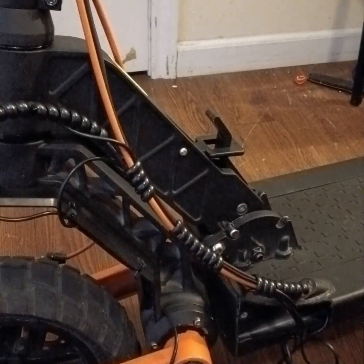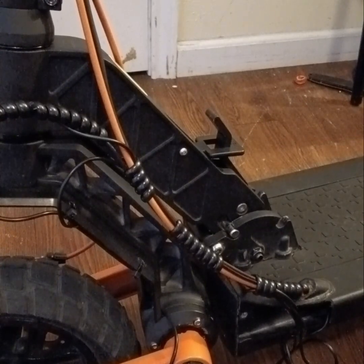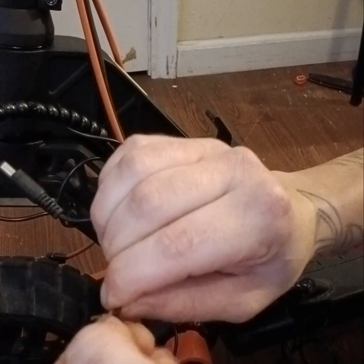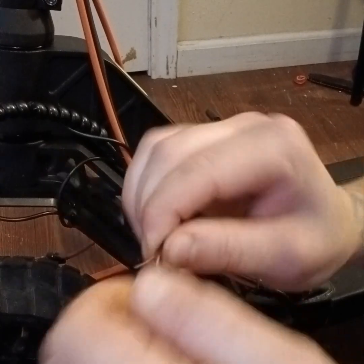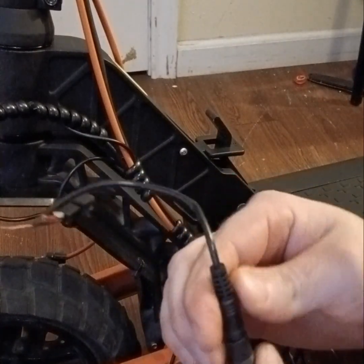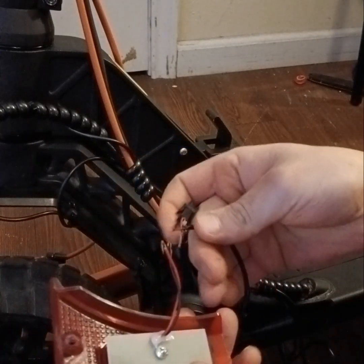You're going to want to splice them all to that one light, just like that. You don't want to make the mistake of cutting all four LEDs to each light, because then it won't work. You need that controller to control the app through your phone. Just plug that back in and hook this back up to your side light here.